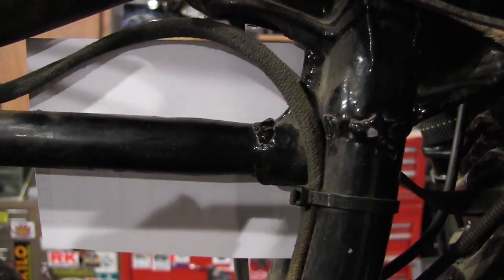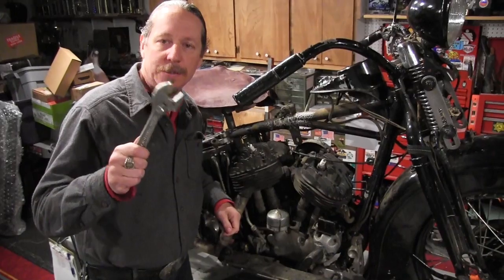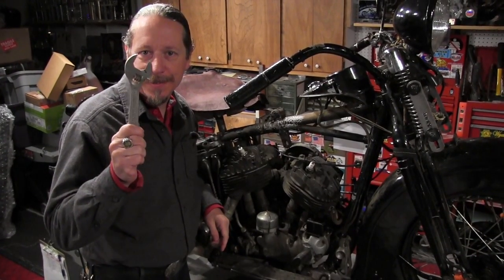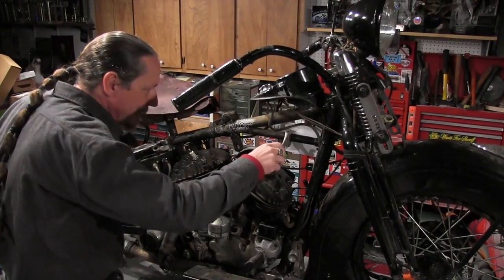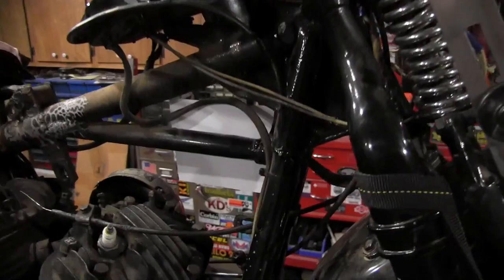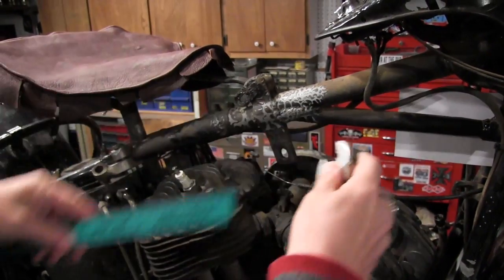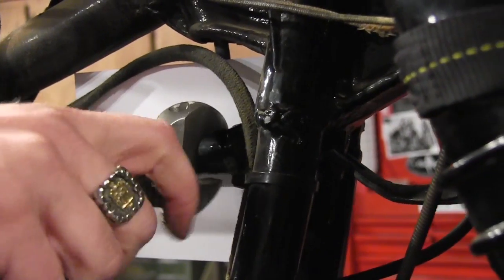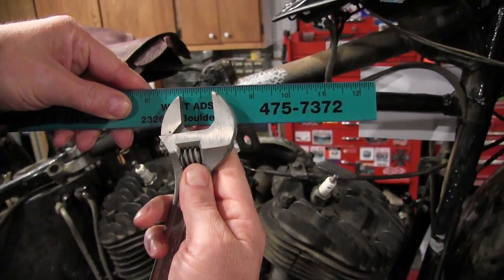And just to illustrate that, you see this? You think you know what this is? You don't. This is a set of calipers. Backwoods rednecks like us, who don't have all the tools in the world, this is a caliper. It's a 2-piece caliper. You need a ruler and a crescent wrench. I'm going to slip this crescent wrench on this bar, nice and tight, then I'm going to show you that that measures clearly 1 inch. Now as I slide my redneck caliper down the tube, look how loose it gets on the end. So now I'm going to recalibrate the diameter of the bar and show you clearly that it is 7/8 of an inch.